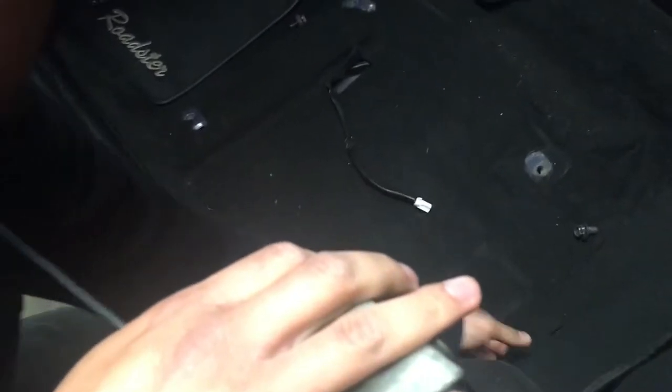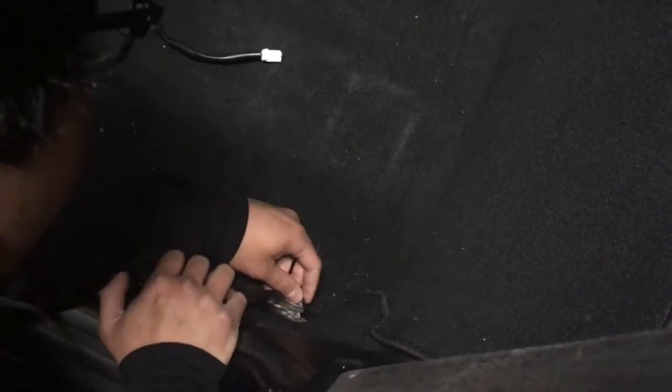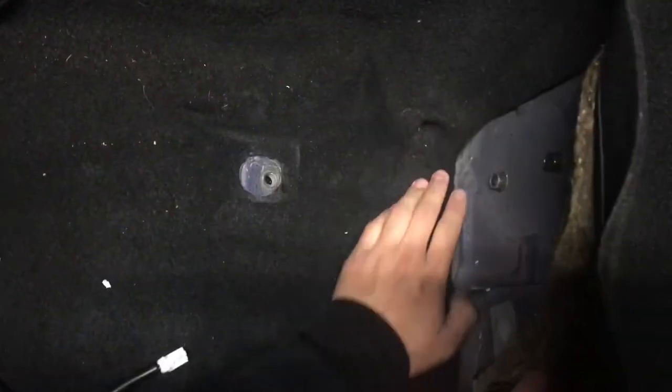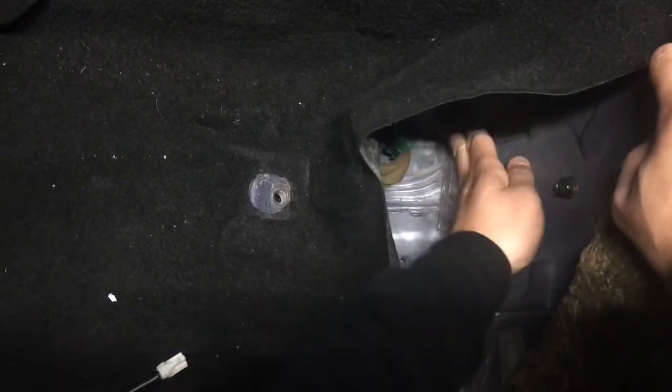All right. Next thing we gotta do is this requires eye bolts for the harnesses. I have to drill one hole for the eye bolts. They all use standard 7/16 grade seatbelt hardware. So right here, gotta find a right point to go drill through. It looks like right under here by the transmission tunnel. We'll go drill that in just a sec.